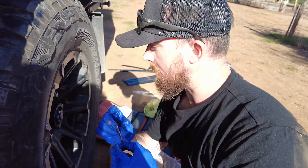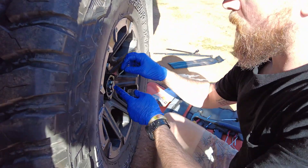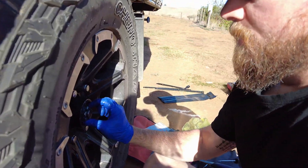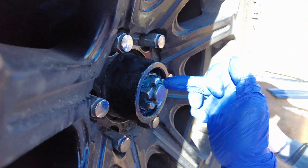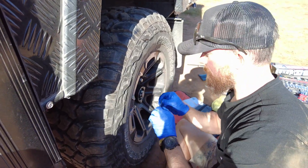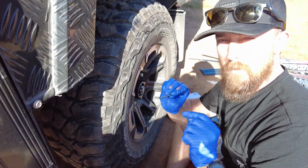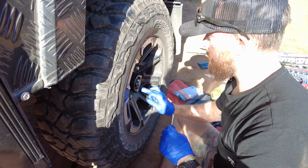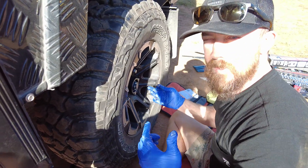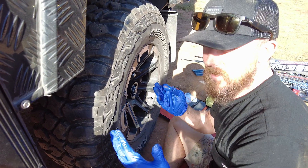So that's your pin there. I've just taken it out and tightened the castle nut one notch — you don't want it overly tight and you especially don't want it loose. It's stopped the wobble; there was a slight wobble on that wheel and it's now pretty much perfect. I'll put the pin back in and bend it back. The lubrication and everything looks really good in there, and obviously we got it recently done, but there is a bit of give.